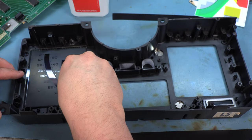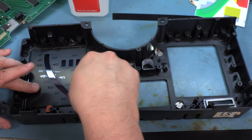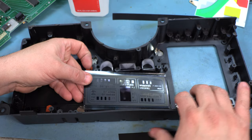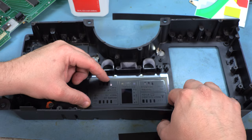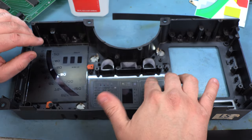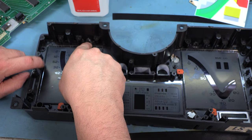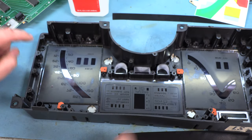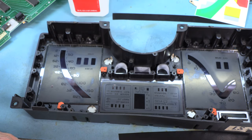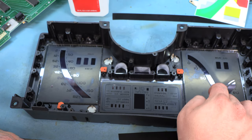Next we're going to place the LCD panels into the plastic housing and install rubber blocks on the top side and the right side of that speedometer panel. We're going to take the center panel, slide it beside this metal leaf spring, and let it drop down so that it's sitting flush in the plastic housing. We've got all of the LCD panels sitting flat on the plastic housing. We see the evil plastic tabs that can smash the edges of these panels — the panel is not sitting on top of any one of those. There are three on the speedometer, three on the center panel, and three on the tachometer panel, and we see that these panels are not sitting on top of any of those.